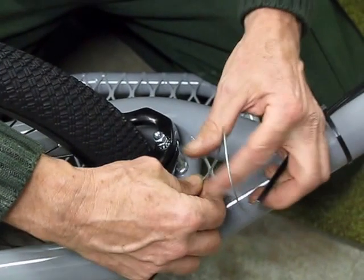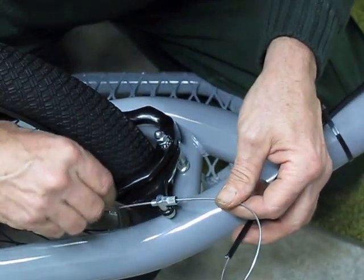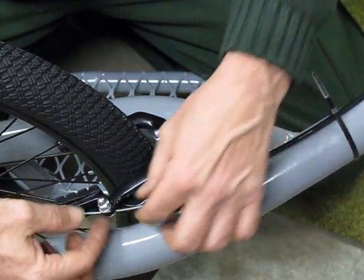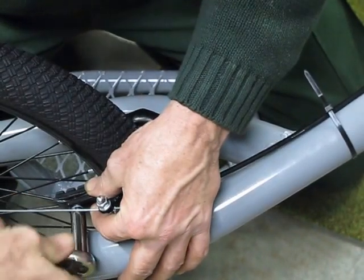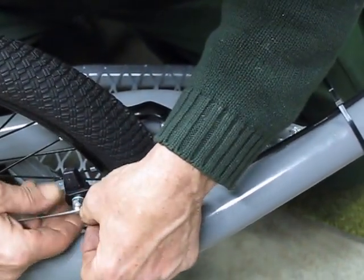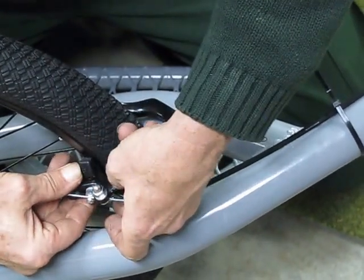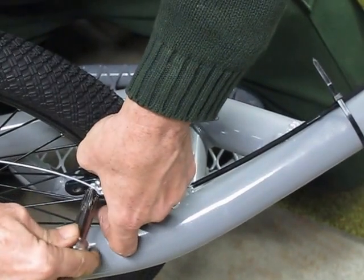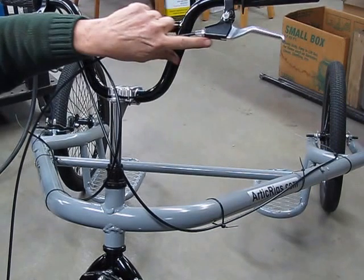Slide your brake cable down through your adjuster. Loosen up your tensioner and slide the cable through the adjuster and through the tensioner. Sometimes you have to slide that up quite a ways — there's a hole through the back side of the tensioner and the cable needs to go through it. Loosen up your shoes on each side. Simply by loosening the shoe, you can slide that shoe into play right up where it needs to go on the rim, but not touching the tire. That way you won't heat up the tire or have any issues down the road. Tighten that up right where it needs to go.